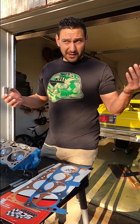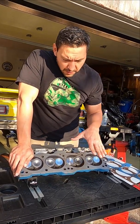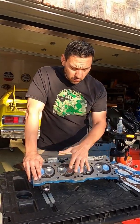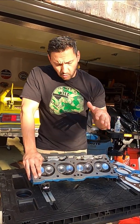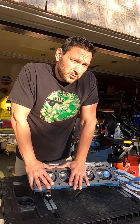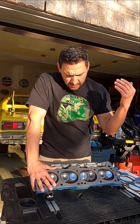You don't want to be too high either, because that has a whole host of other issues. The head is probably the biggest impactor of volume when we're looking at compression. These are 71cc heads. As you're doing your side-by-side calculation and planning ahead, this is one area where you look at where you are now and where you want to be in the long term. I've already specked out that at some point I do want to upgrade to a 63cc head, which brings my compression right up to around 9.2 — the top end of where you can run on pump gas or 87 octane.